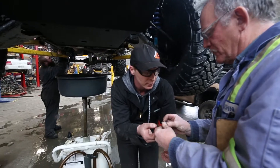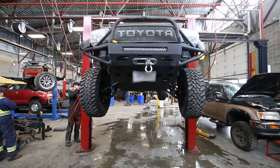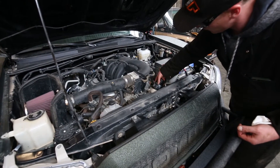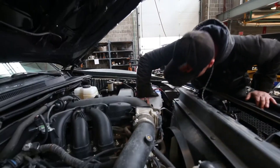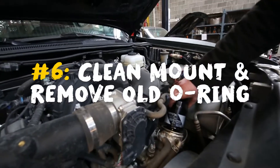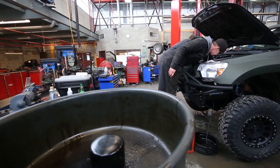Just get the oil plug back in. It's good that they torque oil plugs — if you have never done one before, a lot of times guys figure it's got to be too tight. The filter on this is unfortunate — it's hanging upside down, so when he takes that off there is going to be oil come out of it. He'll flip it around quite quickly so he won't lose too much. It's very important to make sure that the O-ring comes off with the filter and that the mounting surface is clean.